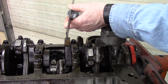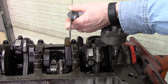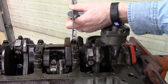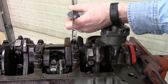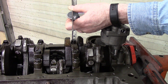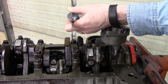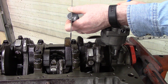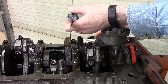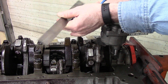Melling recommends that your oil pump pickup be about a half inch above the bottom of the pan. I measured my pan and it is seven and three-eighths of an inch from the mounting edge to the bottom of the pan. So I want to be at about seven inches with my pickup. I hold my pickup at seven inches to the screen and make a mark, then verify again and install my pickup.